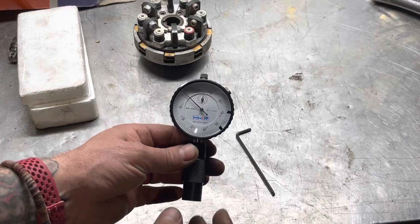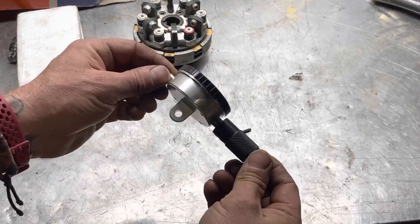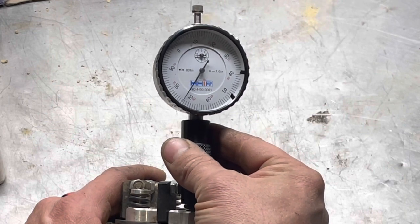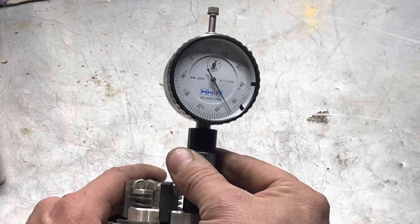Some of the tools of the trade: you need a spring height gauge. I have two of them — one I got from Bully and another I've had for quite a while. You slip it over the top of the clutch spring and it gives you a reading in thousandths of how high that spring is. For example, when I was running my sedan on a jack shaft system with Bully, it was 220 thousandths high with the purple springs bolted in every other lever.